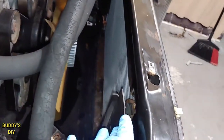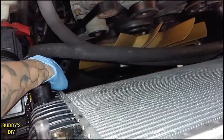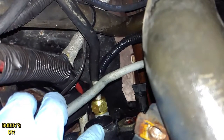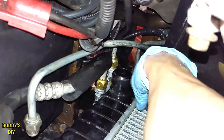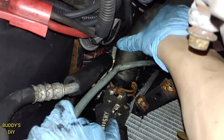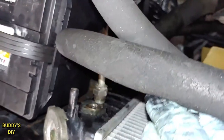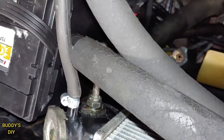With our new condenser fully installed and mounted, it's time to put our radiator back in. Make sure you don't bend any metal lines like your oil cooler and transmission cooler lines. Start with the transmission line, then move up to the coolant hose, then the second transmission line. Push your fan cover out of the way to give yourself enough room to crank down your transmission line. Take the coolant hose, use locking pliers with the hose clamp, put your hose back on, and unlock your locking pliers. Hook up your last transmission line and don't forget your overflow line.